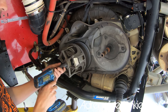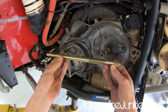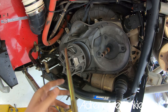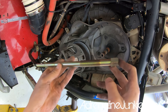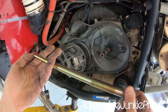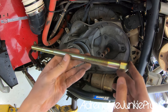The primary bolt is 21mm, pretty easy to get off. Do not use cheap China clutch pullers — the tip can bend and cause damage, or break inside the clutch and you do not want to go there. Spend the extra few bucks and get a reputable quality primary clutch puller like the one from Aftermarket Assassins, not those cheap $20 eBay ones.